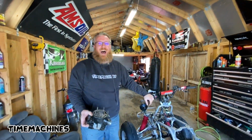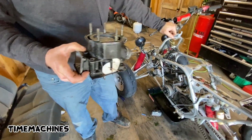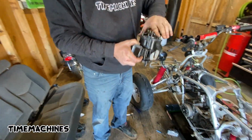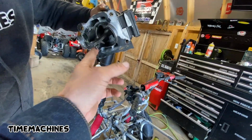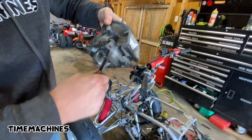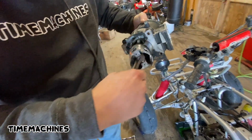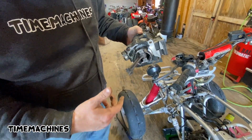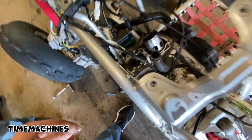Oh, no! No! Dude, no! Yeah, the wrist pin. It was the other bearing that came undone. That's just the wrist pin. Damn. Well, this piston was good. That's a good thing. Y'all want to know why this grenaded? Because when you have oil in your gas, it lubes your crank bearing. And I'm telling you, this thing got hot.